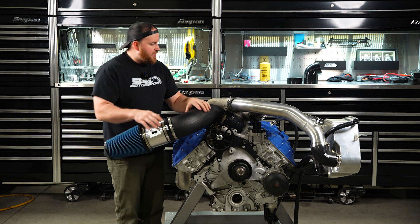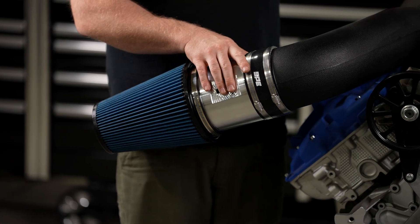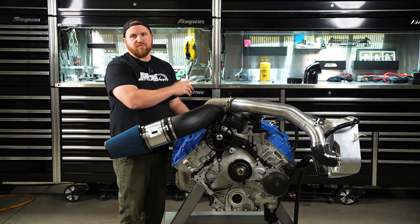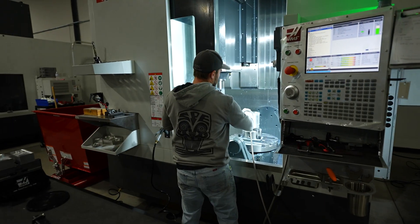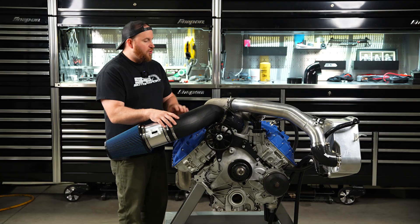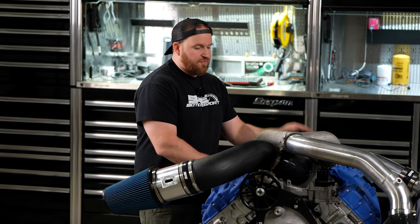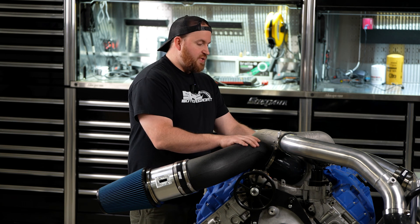The first thing you can see is the air intake. Going to an S400 turbocharger down in the valley, we have to be able to supply it with proper airflow. A standard off-the-shelf cold air intake is not going to work. The lower air intake adapter we run on our S300 Emperor kits is not going to be sufficient for a 400 — we're just flowing too much air, it'll be restrictive. We have a really nice billet mass airflow housing, so for anyone tuning, it's the same every time — not roto-molded. A nice six-inch filter and a huge five-inch ID air intake tube that goes all the way down to the S400. We need no restrictions on the air intake track because the 400 can supply up to 1200 horsepower worth of air, so we need a lot of inlet flow.